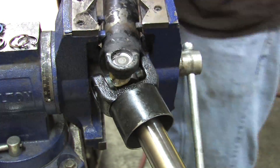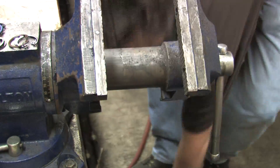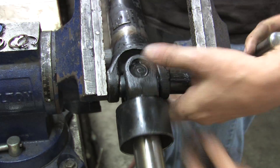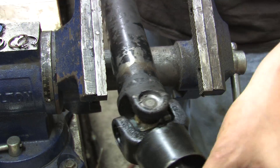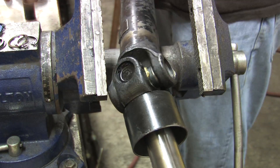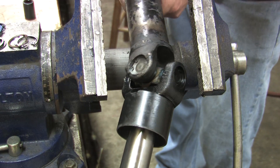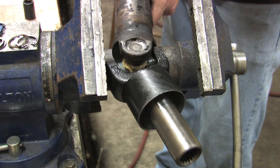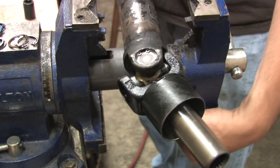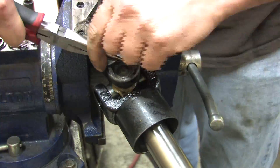That means only one set of snap rings is correct. The service manual says to use a brass punch and knock the caps to one side with a hammer and check it with a feeler gauge, but good luck finding one that small. Since we don't have a feeler gauge that small, we're improvising — using a 10 millimeter socket against the cap to accomplish the same thing. There shouldn't be a gap you can see or feel, and the joint shouldn't be loose and floppy. It should require at least a tap with the socket and a hammer to drive them home. If the snap rings seat easily, bet that they're the wrong ones.